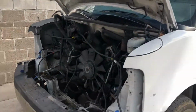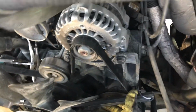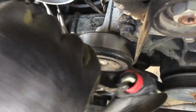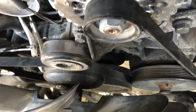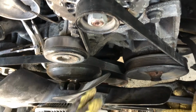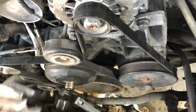All right. So this fan right here, getting this fan off was a headache, and you got to get in behind here to the nut that holds the radiator fan on there, and then you turn that. Right there, leave it right there. I can see where you're at. You're holding the nut right there. You hook this on, and it goes counterclockwise with how the fan spins, and you just keep on cranking it all the way around, and see how that bell housing, that metal circle thing right there, is staying still because I clamped it. And the fan nut shouldn't be on too tight, you just got to apply some pressure. Woo! And there it goes.